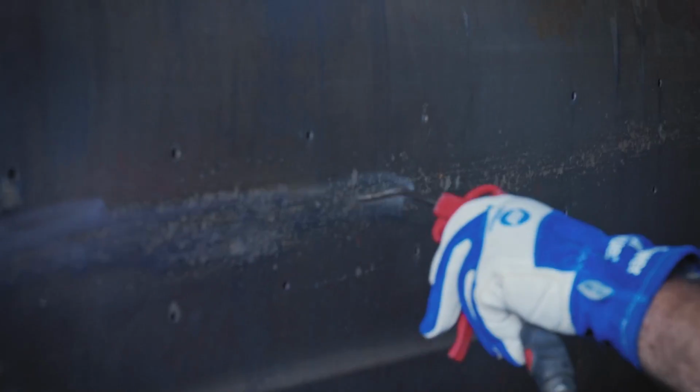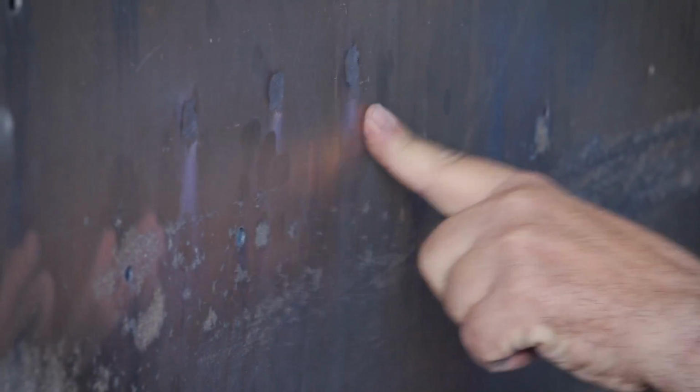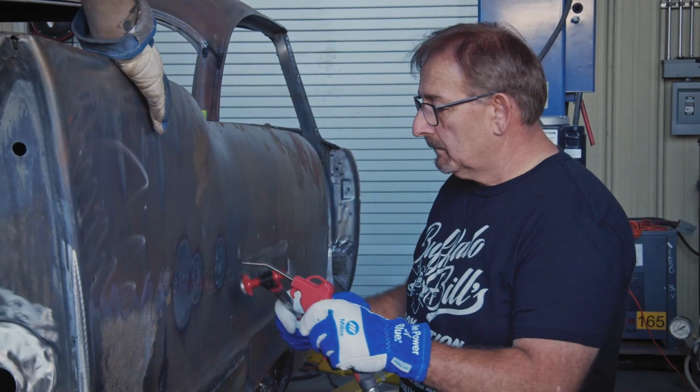If you don't take the extra metal out, if you try to straighten a panel, you can just pour Bondo, filler, on it until it finally bridges and it has a flat finish to it. But it won't stay, it'll crack back out again. That metal will continue to move every time you go over a bump. Remember, you can see it in the picture. If it moves like that with your hand, it's gonna move like that going down the road. So if you're going to do a proper repair, you have to shrink the metal in those areas.